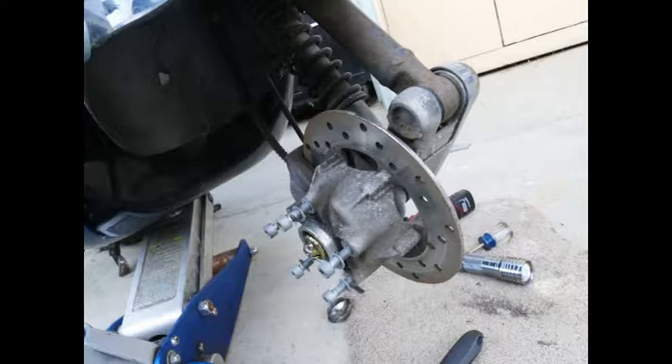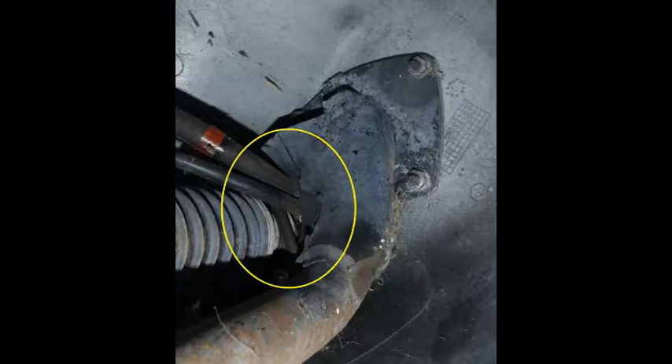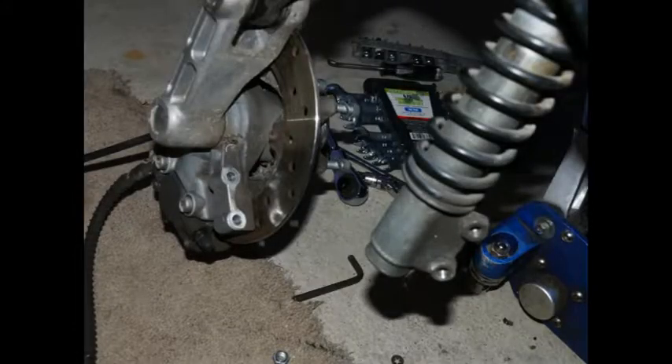The downside: if you ever had to take the fender off because it got damaged, you'd have to take the whole front end off, which is a nightmare. On my friend's scooter, after just 3,500 miles, it caused the speedometer to stop working and the brake hose to completely clog. The reason is that it takes a sharp 90-degree bend as it comes down the stem through the shock area, putting the brake hose and speedometer cable under tremendous and unnatural stress. That shortens the life of both and leads to a very expensive repair. By comparison, my 2005 Kymco Grand Vista 250 has 24,000 miles with no such issues, and if it did need those parts, it would be a piece of cake.